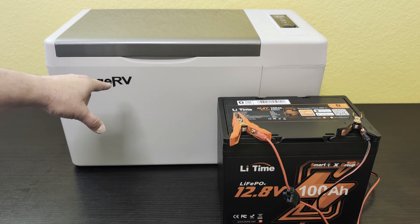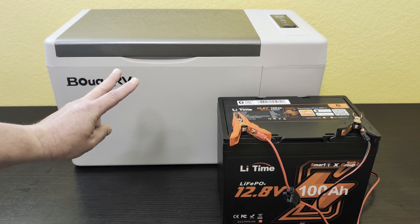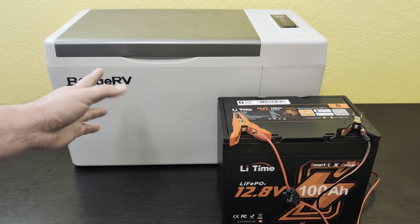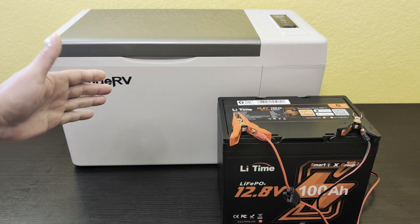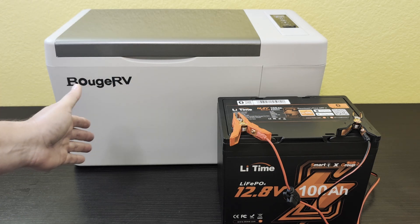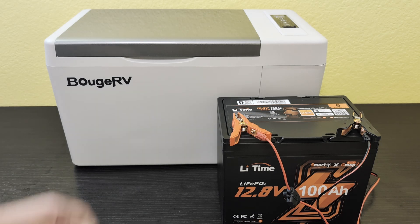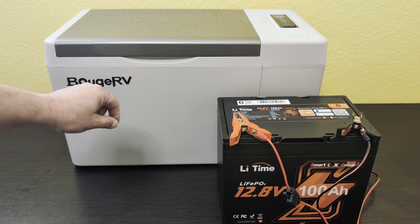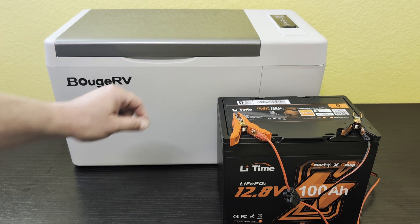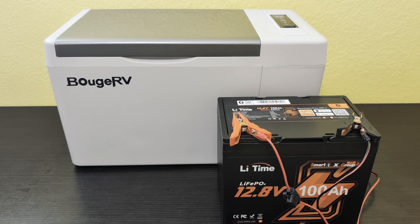I opened the fridge multiple times a day to check the temperature gauge. What I noticed was each time I opened the lid, checked the gauge, and closed it, I'd lose about two degrees of temperature. Sometimes just one degree, but two degrees was typical. The compressor made that up really quickly though — as soon as it kicks on, the temperature drops fast. So almost six days is great. I'm going to round that to five days for practical planning purposes. I'll put links to every product used — the refrigerator, the battery, and the alligator clip socket connector — in the description below. I hope this was helpful. Thank you for watching — y'all take care.